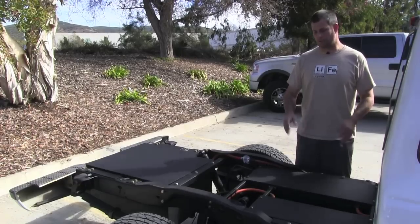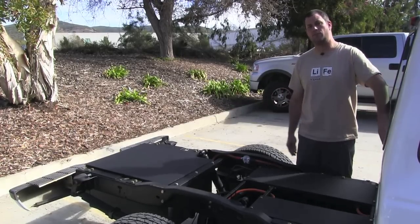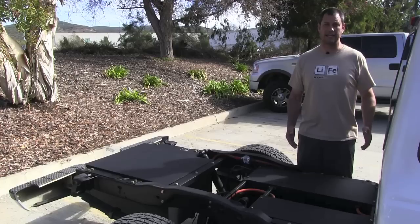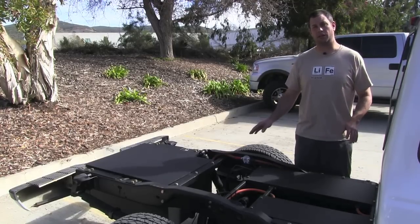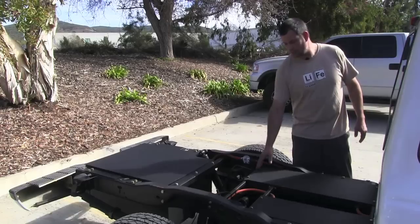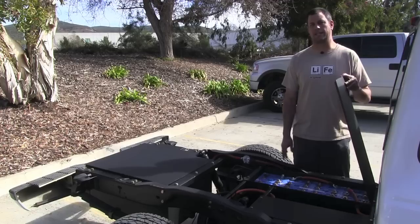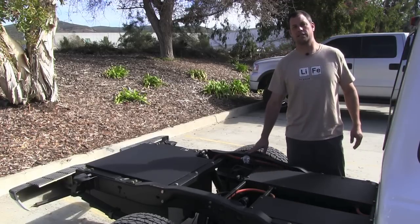Here we are at the back of the Ranger. We have three separate battery packs in the rear, and we actually have one more in the extra cab — what we call our range extender. It's a smaller pack and it's actually removable if we ever need extra cargo space. Our three battery boxes back here are made out of 3/16ths aluminum, welded up and coated in a chip guard. We use marine starboard for covers so our batteries are underneath, keeping them out of the environment and held securely, especially when the bed is bolted on top.